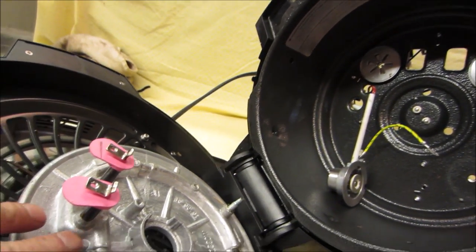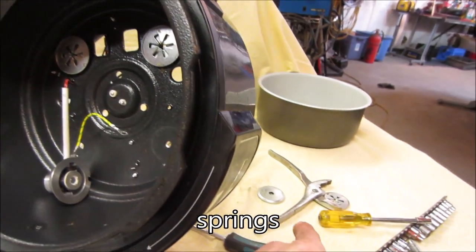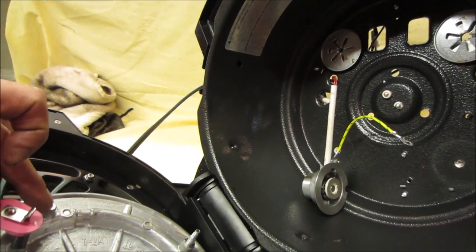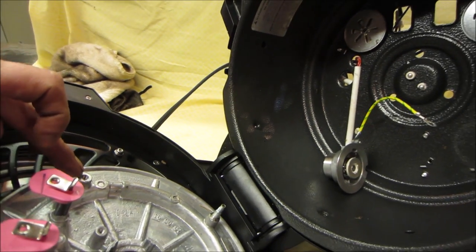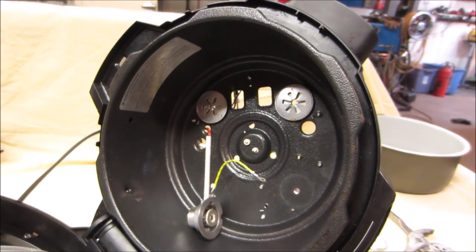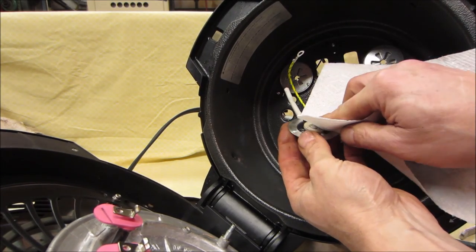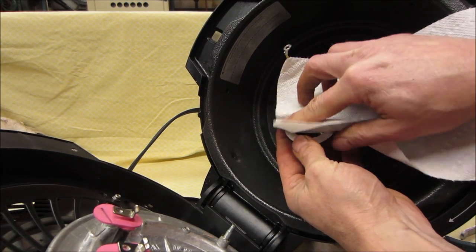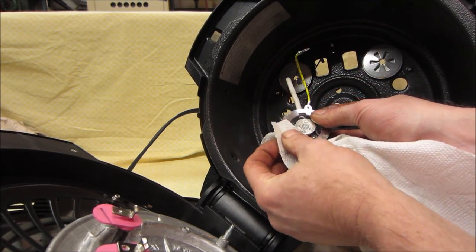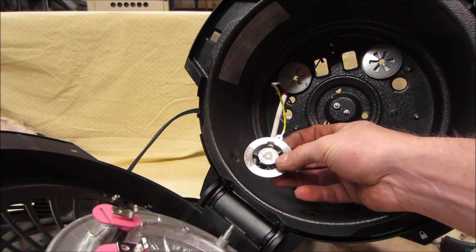That sits spring loaded back in this holster. I'll stack that material on these standoffs — it's got a bunch of isolators. I'll see if I can get all that put back into place, power it up and see what happens. I've got some electrical contact cleaner — let's see if that'll be enough to break that stuff up. The unit's not exactly cheap — I think it's 170 bucks — so I'd like to give it a chance. It didn't do anything though. I'm going to have to go for thinner, acetone, or something to wipe it off.